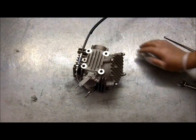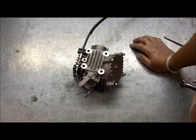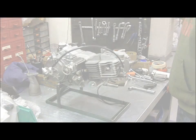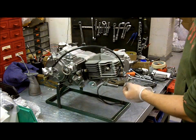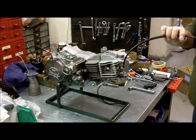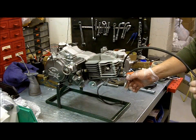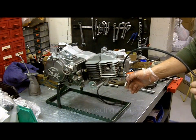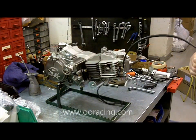I'm going to show you how it now works on the engine, so you can see the difference of it actually releasing the gases out through the exhaust valve and how easy it is to find the point of starting. Now we're all installed — the bracket's on, it's actuating the valve inside. If we just check the actuation of it, we can see it's a nice smooth operation. And you can also just check — you can just feel the resistance at the end of the valve, just touching there. So we know we've got enough free play in that.